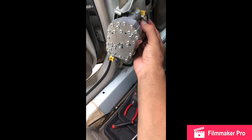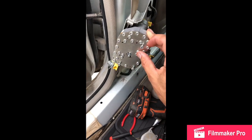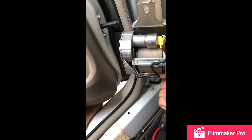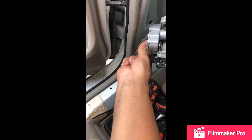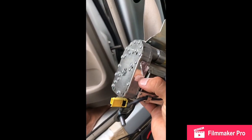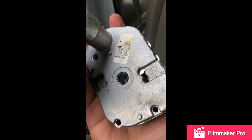I've loosened up the three bolts — again, they're the ones with the bigger head compared to the rest, and there are only three of them. They're also longer, and you can see them on the back end — on the top and the bottom. Once the bolts are off, you can wiggle this part off; it might be tight the first time. Then you're able to wiggle this part off and there's the shaft. Once you take it off, you're going to find those little pins inside.